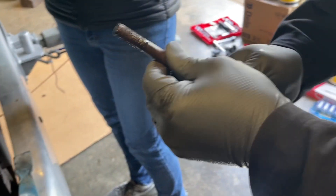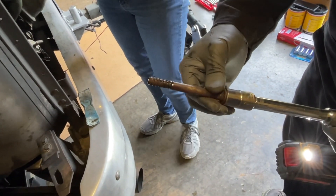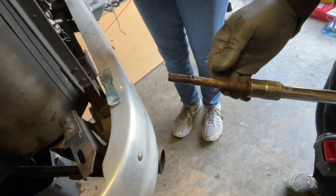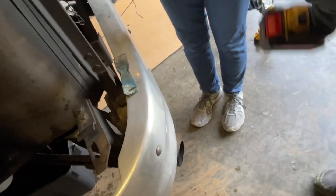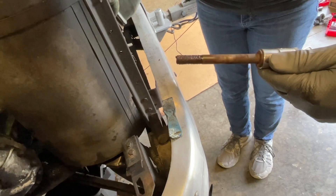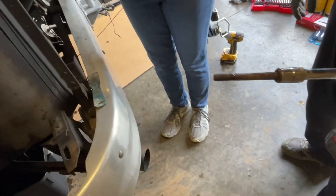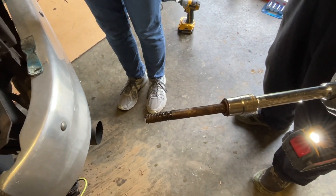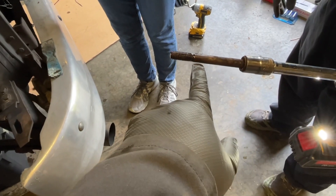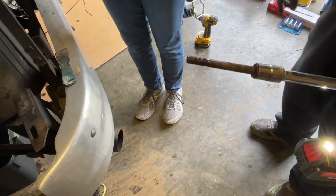You don't like that bolt? What's the matter with the bolt — is it crunchy? Yeah, and it's like not round. It's been stretched. Somebody torqued it and it's been stretched. See, it's not spinning straight. So the torque will tweak it, and that's how you know that bolt's done. That's special though — see how short the threads are? Is that a tractor supply bolt? We'll find that at tractor supply — is there one around here? Yeah. Okay.